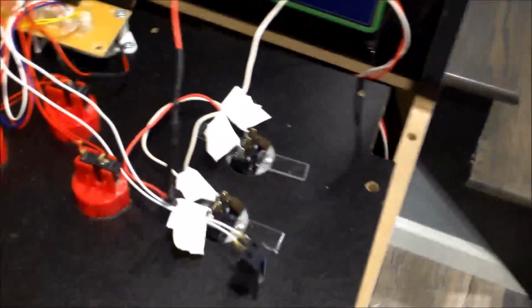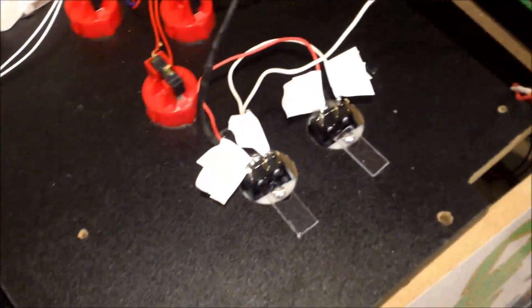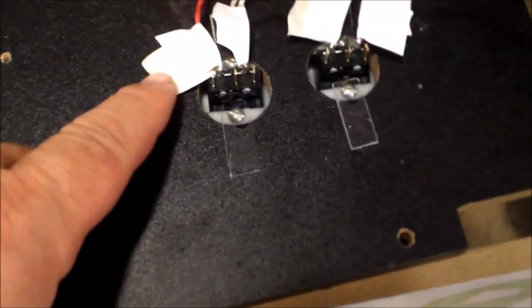Okay, as far as the wiring goes for these switches, I have the Arcade Game Factory marquees on all my machines. I'm just going to tap right into the 12 volts coming from that. If I look behind it, they give you a little toggle switch, and then the wires come off the toggle switch. Long story short, there's 12 volts coming in here, and I'm just using that 12 volts. It's going to come out here and feed each switch.